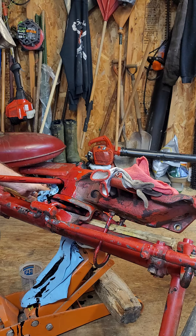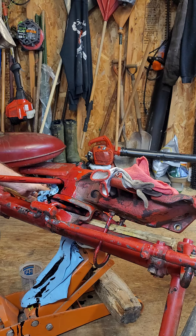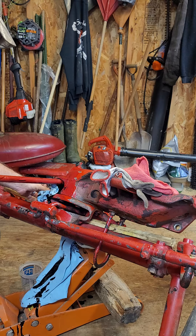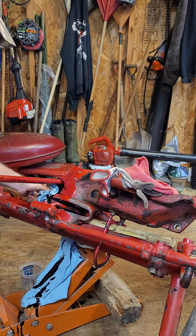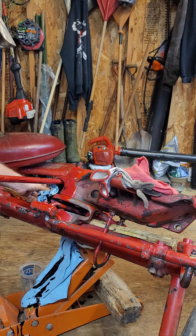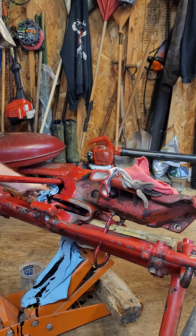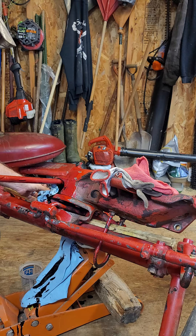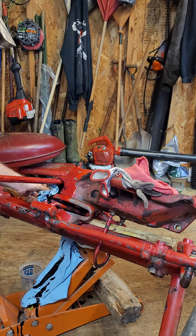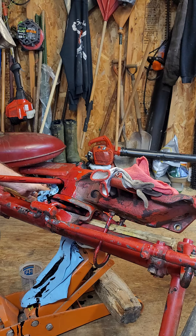This is the kit that I got from Steiner. It comes with two new seals, the large and small bearing, new keyways, sleeves, and the seal. Like I said, I'm hoping I don't need a sector shaft and hoping I don't need that new gear inside there — but we're going to find out obviously soon enough. Whenever you think it's a certain size bolt, go one size bigger — seems like it never fails. That came off pretty easy.